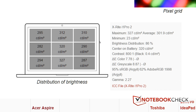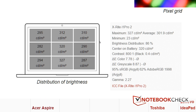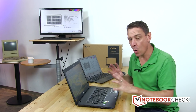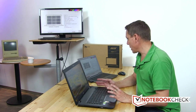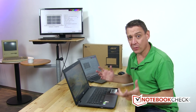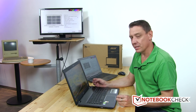The Delta E — the variance between displayed colour and real colours — is seven or more out of the box. It can be calibrated a bit, but that's not fantastic. For the target audience of general home multimedia or home office work where accurate colours aren't critical — not photography or videography — that's actually not too bad. Contrast of 800:1 is quite good, black levels were good, and the colour space covers 95% of sRGB, so that's okay. The screen is a lot better than last year's model, so Acer have done a good job upgrading that.